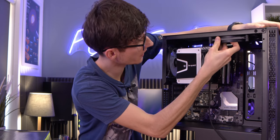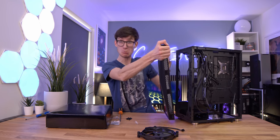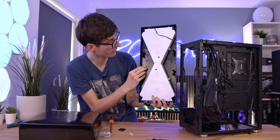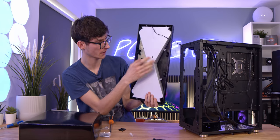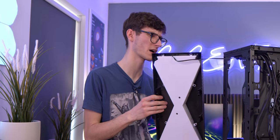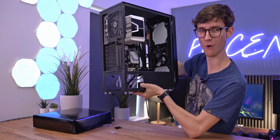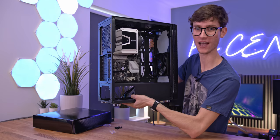You could put the extra fan at the top blowing down and create a loop of air. You can really see the extent of the airflow problem - just how much mass you have in front of it. The only bit of airflow you have is from the side vents rather than the front itself. I think it will be fine for a build like this, but it really is not going to be very suitable for an RTX 3070 or above. My money is on it running warm but fine - but running without a front fan at all is not something I would want to try.